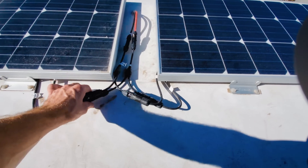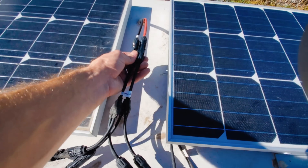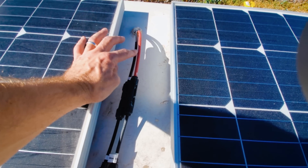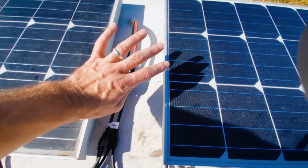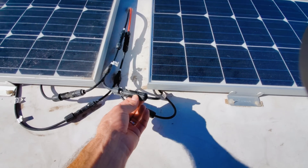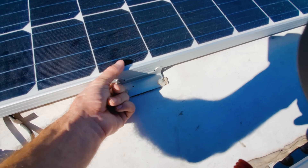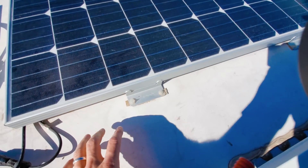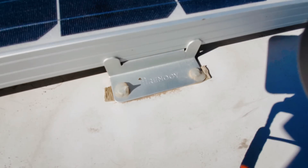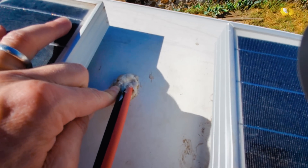Just have the leads coming out of one panel and the other, going into a Y connector to combine both panels down to one wire, which connects to this PV cable — photovoltaic cable. All this stuff you can get online on Amazon, really easily. If you do it that way, you might spend a little bit more, but you get all the connectors and you're not having to solder. I figure out where I want the panels, attach the brackets, set it on here, mark all the holes. Then I come back and put mollies in each hole, drill them in, and put little beads of silicone on top of each so they don't leak into the camper.